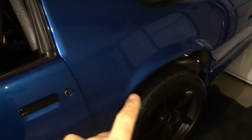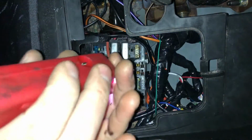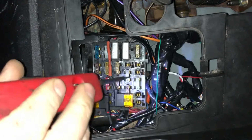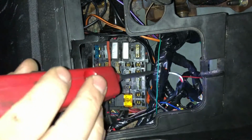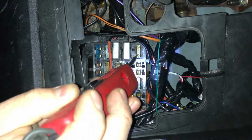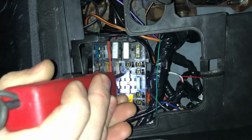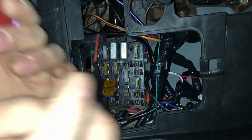Now I'm just gonna reconnect the connector back onto the pump because I'm done back there. Now I'm gonna just go through the fuses under here with the probe. I'm just gonna check them all, make sure none are blown. This is the stuff I have, this is just tapped in for the backup camera. So right now I'm just gonna make sure I have power on each side of the fuse as well. It'll probably help if the ignition was on too. Okay, ignition is on. Power, power. Power, power. Good. What's going on here?